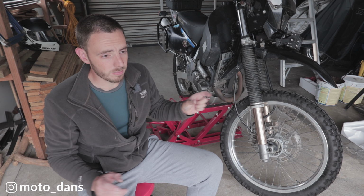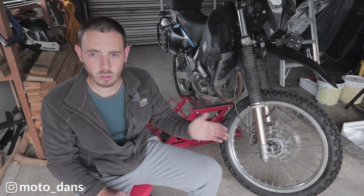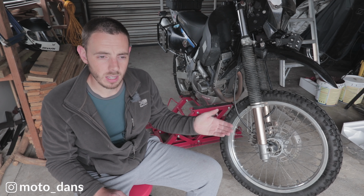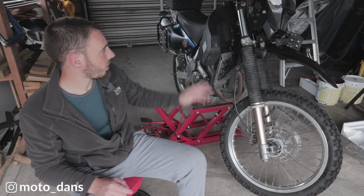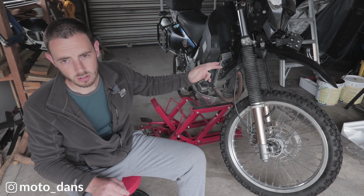So basically what that means is my spacers that I cut at 16mm need to be 9mm. So I made them 10mm too big, and I didn't accommodate for a 3mm preload, so I need to make them 9mm wide. So I'll get them cut just now, and then we'll just pop out the old ones and pop on the new ones.